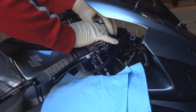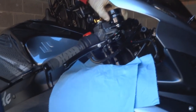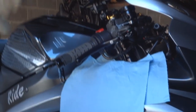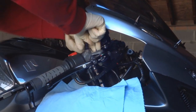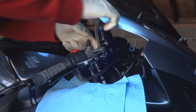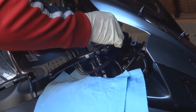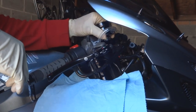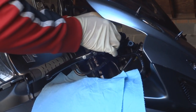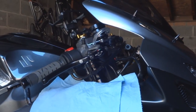We're going to try cutting the hose a little bit so that it works better. So we cut the hose down a little bit and we're going to re-try positioning it to fit the master cylinder and the reservoir. I think that's it — the kink is reduced and everything is fitting in correctly. That'll work.